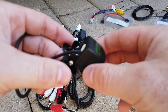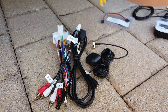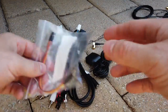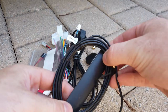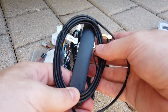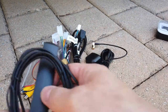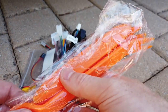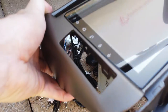For the GPS on this model you can mount it on top of the back of the head unit for good reception since there's no steel above it, or run it further out - the main point is to have no metal above it so it has a clear view of the sky. There's also a reverse camera for the GX model, a Wi-Fi antenna on an extension cable, an OBD2 scan tool, trim removal tools, and the main head unit itself.